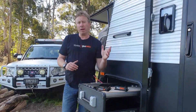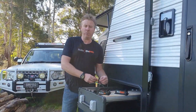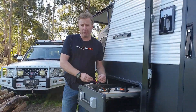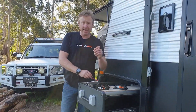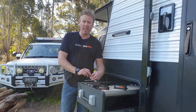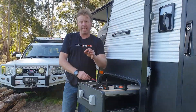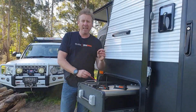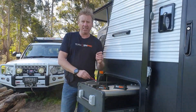Now it's got a battery chemistry wire. So from a tech tip perspective, make sure this green wire here — which you'll find in your manual with exactly where to wire it to — controls your battery chemistries. If somebody says their battery is not getting charged properly, tech tip: it's probably because they haven't wired in this green wire to where it's supposed to go. We sometimes put it on a positive line, a negative line, a solar line, and all of that will dictate what chemistry we are charging and what algorithm we are using for actually charging with.